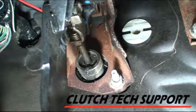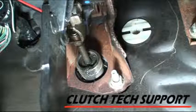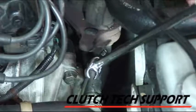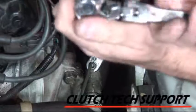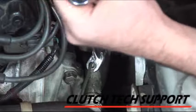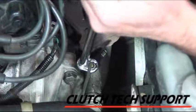I think we found one of our issues. If fluid can get out of this master cylinder underneath the dash, air can also get in. This is a real good time to use the right kind of wrench — this is a 10-millimeter crow's foot. I'm going to put it on the line down there and get everything nice and squared up. That was easy.